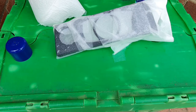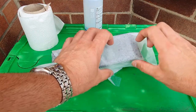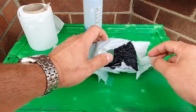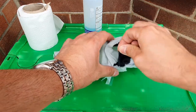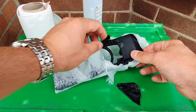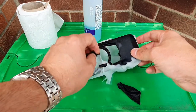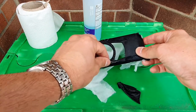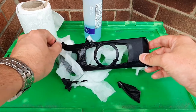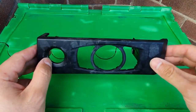After five minutes, we'll peel back the tissue - and as you can see it's actually come off in almost one piece, which is a great result and exactly what we wanted. What we'll do now is remove the rest of the old paint and then give it a light key with some 1500 grit sandpaper, and then we're ready to paint.